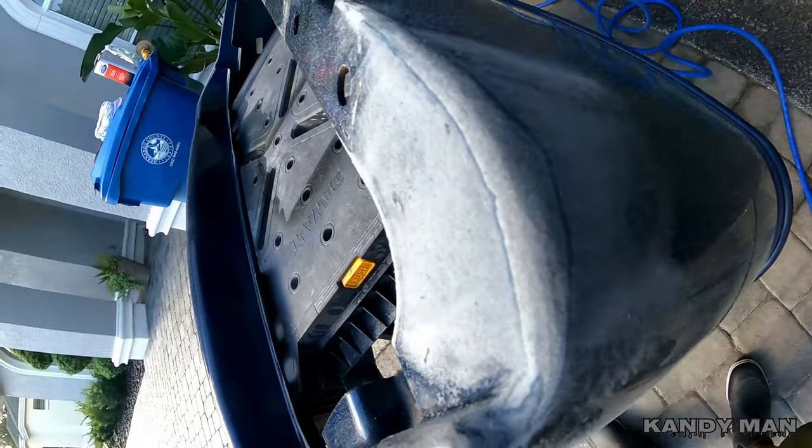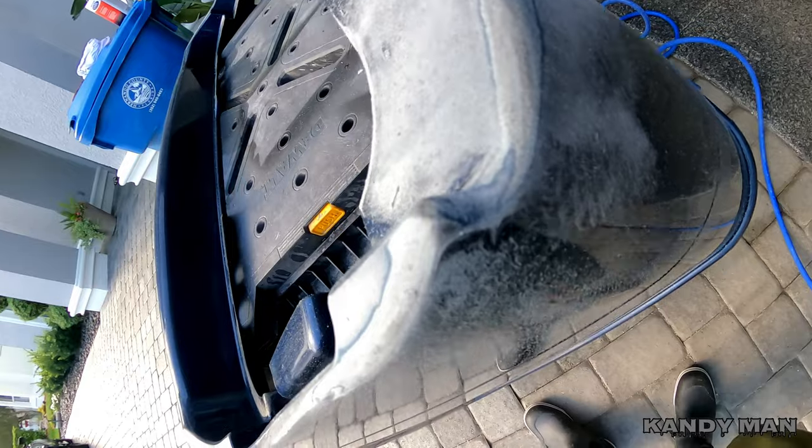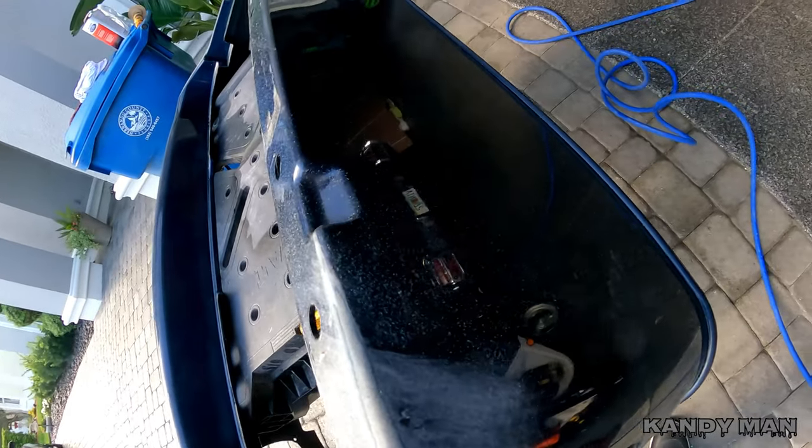You see what I mean about taking out the gouges — you just want to make sure you hold it flat and work the contour of whatever you're doing. You can sand out quite a bit on a plastic part. Let's go ahead and finish this thing up.